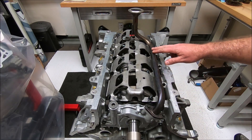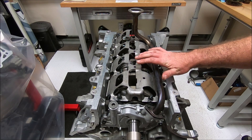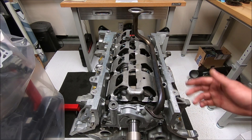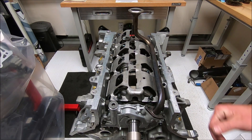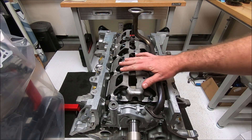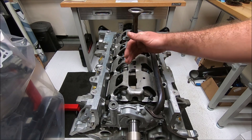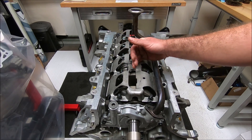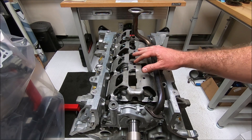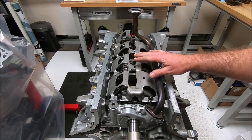This is a three-valve pickup tube — it doesn't have the crank scraper on there. And this is a billet gear oil pump. What the windage tray does is it blocks the windage created from the reciprocating assembly inside the short block. As it rotates it creates wind, which becomes aerated with oil and creates friction on the rotating assembly, robbing horsepower.